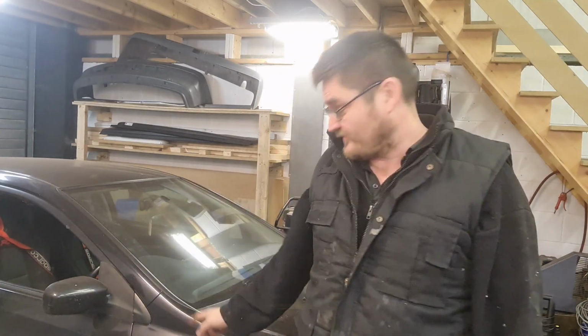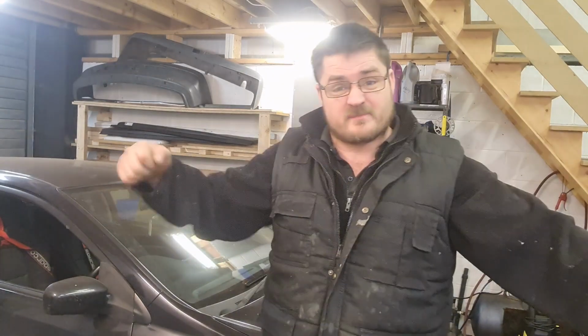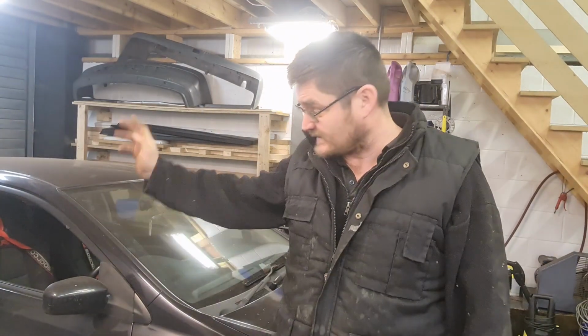Yeah, it took quite a bit more doing than I thought it would. However, it's done. In theory, I should never have to deal with, certainly not that part again, in the whole life that we've got this car now. It's good and solid. I've got some wax oil on order and a long tube and a pump. I'll pop the rear speaker out, ram the pipe all the way down, and wax oil it from the inside, and that should protect it all the way up there. I'll probably do a future video on that. I've got the wax oil on order for another job altogether.